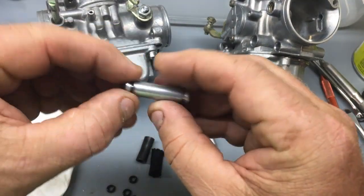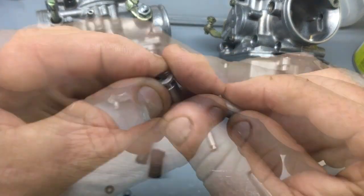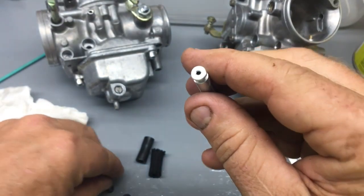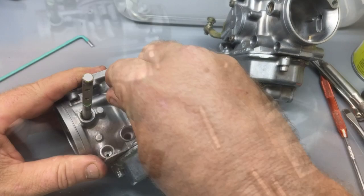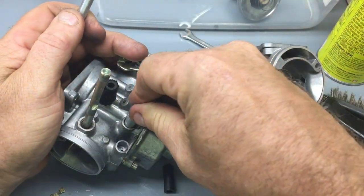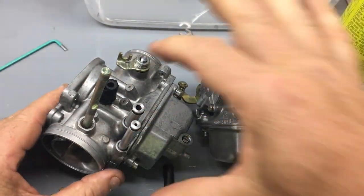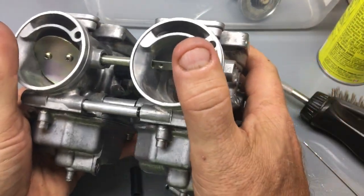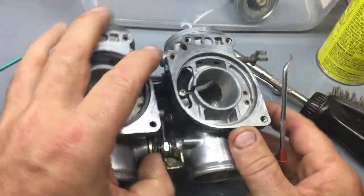The easiest way to seat new gaskets is to spray them with silicone lubricant. They'll just slide into place and they always seem to seat just beautifully. Putting the carbs back together is a tricky operation. The tubes all need to line up and the linkage for the choke and throttle cables have to be just right before they'll reconnect.